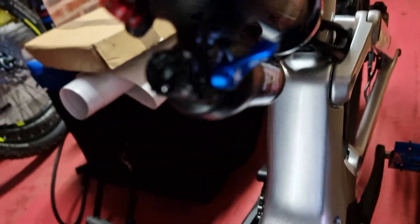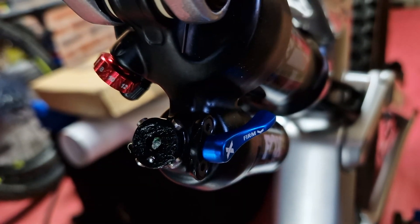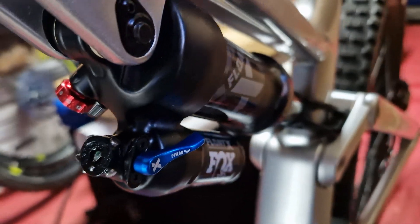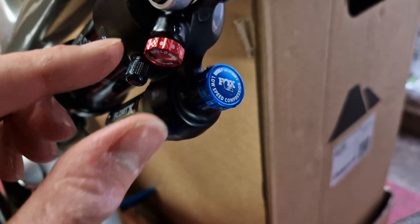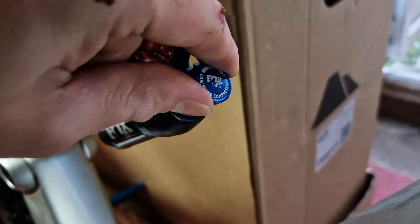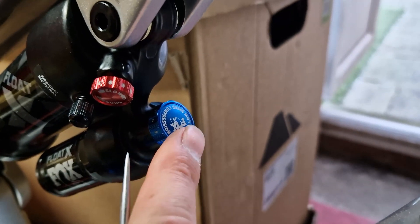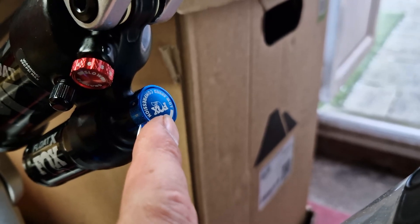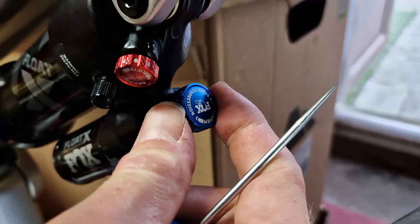You put it with the bearing inwards. Don't push them in too far, but enough so the cap can fit in overall. The grease will hold them and stop them from falling apart. When fitting the cap, get it on slightly then use a fine pick to gently push it in and just get it lipped over slightly — not a lot, just a little bit. Do alternate sides, and once you've got it hooked, the button just pushes straight on. It doesn't come off because those bearings and pins keep it in place.